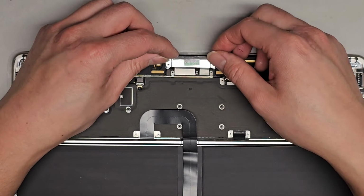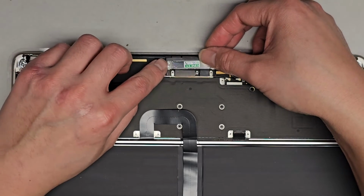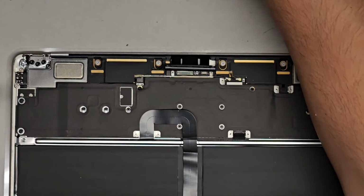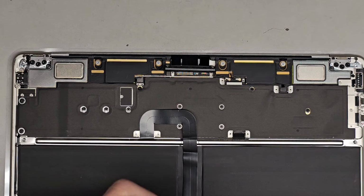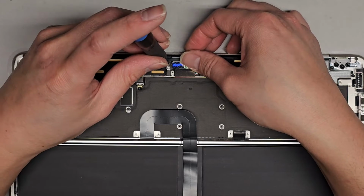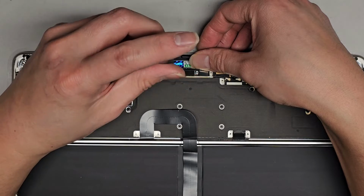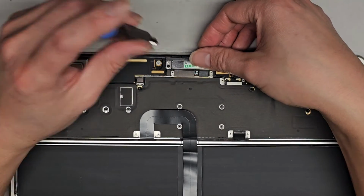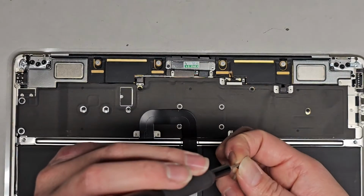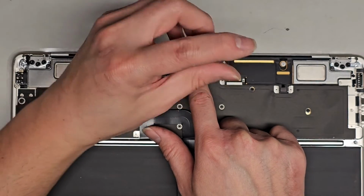We had this, it rotates over this way, and you want to click these in. So we can actually put this in first, those two screws. Those are the T3, I believe. Okay, Torx 3 screwdriver. Flip that over. Get that lined up. Okay, and make sure it's lined up. Get that screw in. I'm loosely fitting it first because I want to make sure I can push those connectors down. So we're just going to loosely fit these screws.